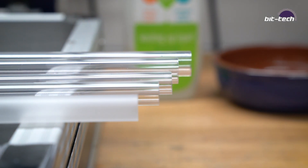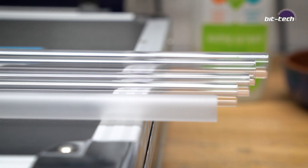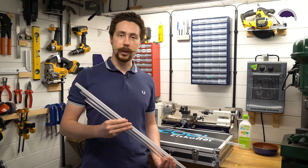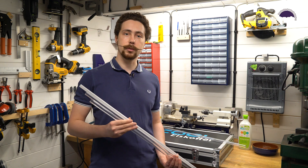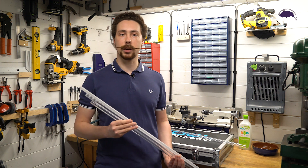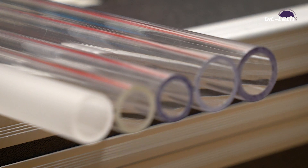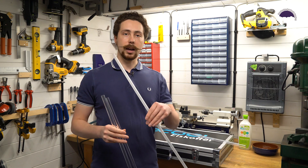The second material is acrylic tubing, which has been used since 2012. Like PETG, it comes in 16mm and 12mm, as well as 14mm and 13mm for different manufacturers. It's always important to make sure you go with exactly the same size as the fittings that you've chosen. It also comes in numerous finishes such as polished, coloured, and satin.